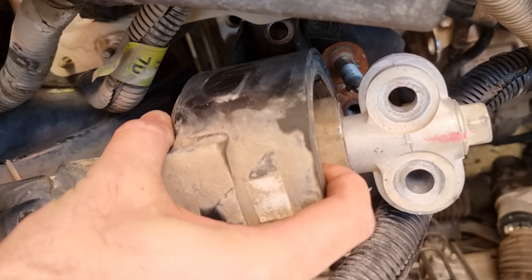How do we know that the engine mount is damaged? The engine sits slightly lower to the right side — but make sure to check that on a flat surface. And second, you will be able to feel the engine vibrating too much. Here's a vibration tester; we're gonna compare it after replacing the engine mount to see how much difference we make.